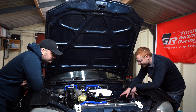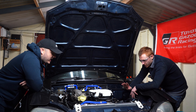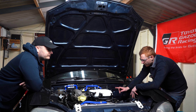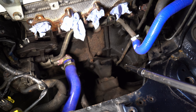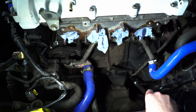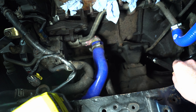So what we're going to do next: the instructions state to put on the manifold — the G19 manifold. But because I am using the G19 dipstick oil return, I'm going to fit that now and I will show you why. There's the dipstick — I've got my little pointy tool, it goes right to the sump, just down there. Once we've got the manifold on and the turbo and the downpipe, there is not going to be very good access, so I'm going to do that now — well, next time.